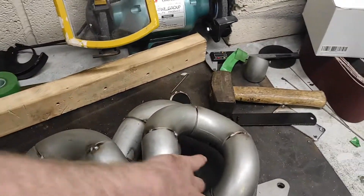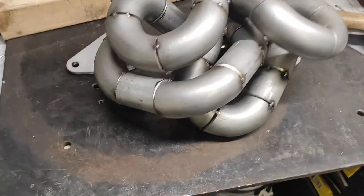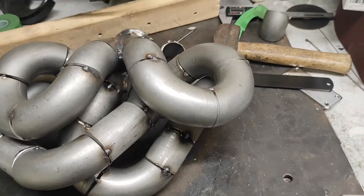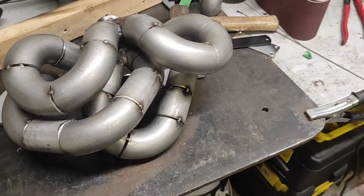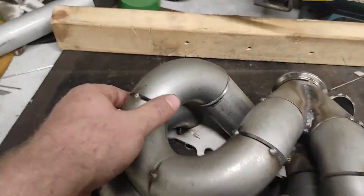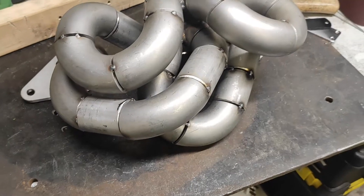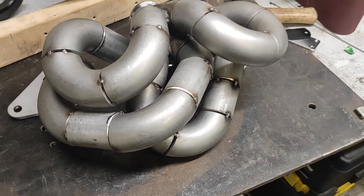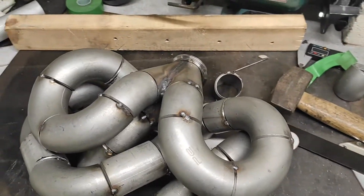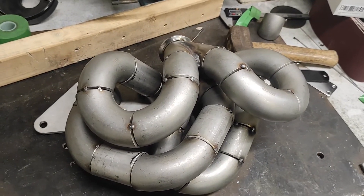Back off the car again. What I need to do is take it apart, take the pipes off one by one and get them purged up. I did run out of gas completely on my TIG welder, so I quickly got the MIG out just to tack it together so at least I know where I'm going with it. I've taken them all apart, given them all a good cleanup. I'll get some argon and get this welded up — I think that will be for the next video. Cheers.